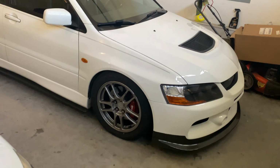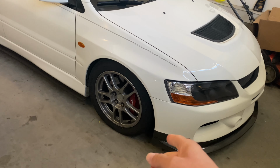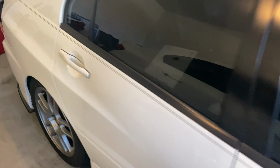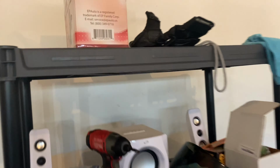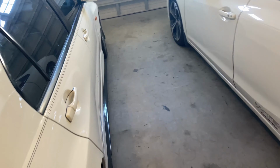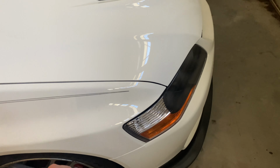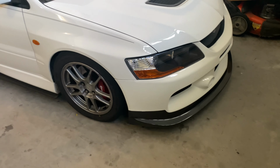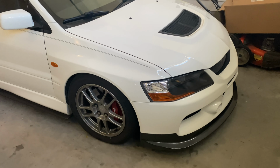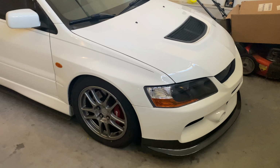As it turns out, we thought for the second run that we ended up raising the tire pressure. In actuality, we didn't. So there's something wrong with that gauge. It's one of those little Amazon gauge things. It works, it'll pump air, but it seems like the actual gauge that tells you how much pressure is in there is screwed up. So it ended up being the same PSI, which is why the car bogged twice during that second run. I tried to slip the clutch, and it bogged once, and I let it go again, and it bogged again.